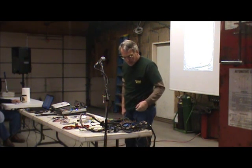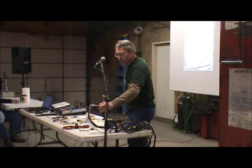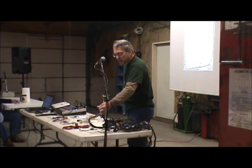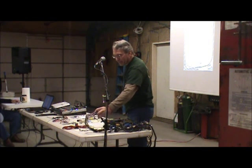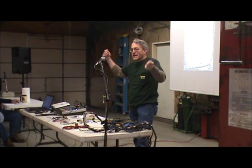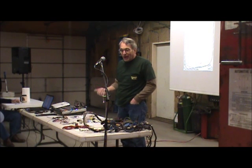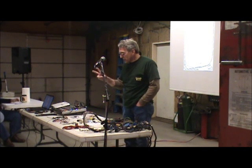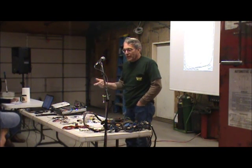One of the other things we also see is, I guess this is the reason the customer cut this open, is this wire is melted. I've seen wire harnesses, the whole length of the harness, one wire is just peeking out all the way down the length of the harness. A lot of times that's a ground fault. Two things cause that, and they're working together. Conspiracy, sounds like to me, is a fusing problem and a grounding problem.